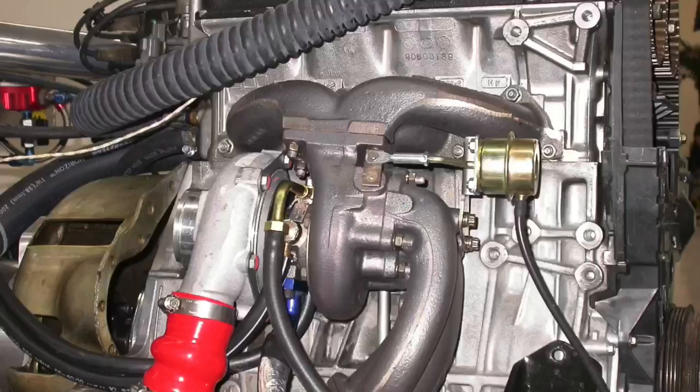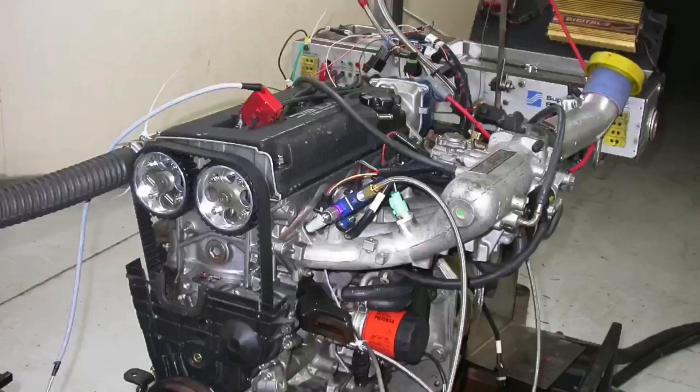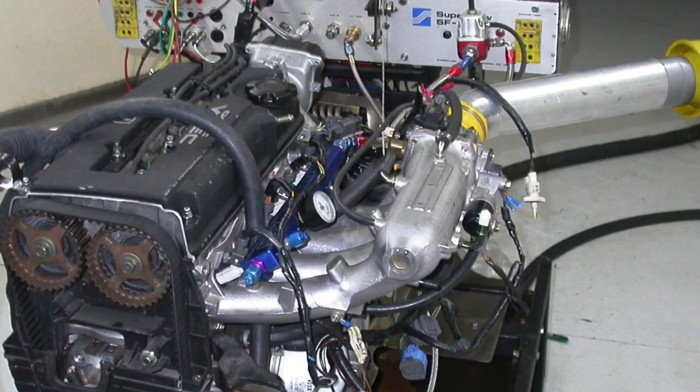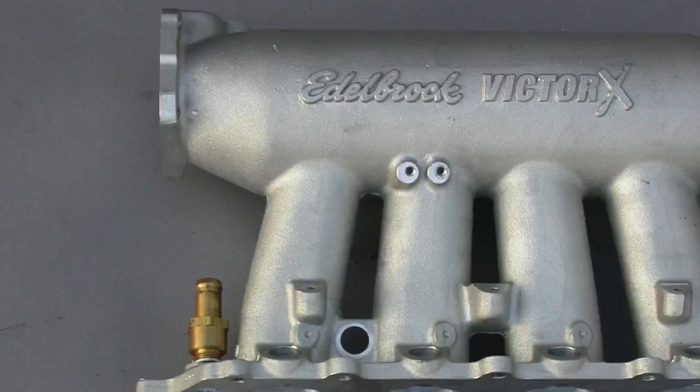In this video we're going to take a look at a very cool test run on a turbocharged Honda B16A. We're going to demonstrate the effect of intake design on a turbo application — actually it's the same effect on a naturally aspirated combination — but we did our test on a turbo B16A. We're comparing the stock P30 factory B16A intake manifold to the Edelbrock Victor X, which is a short runner big plenum design. What happens to boost? What happens to power? Let's take a look.